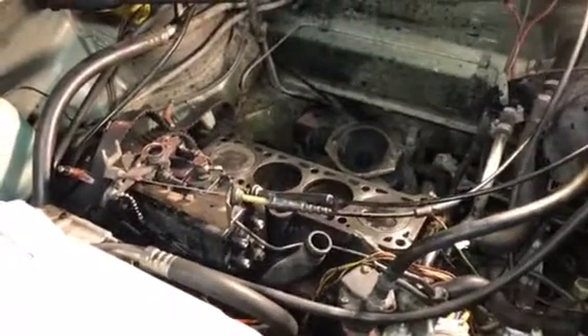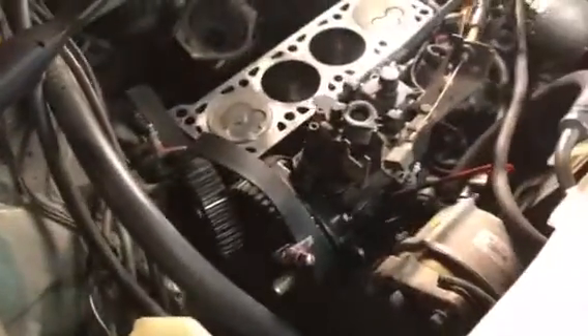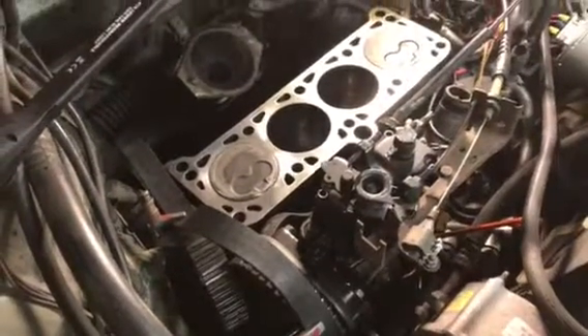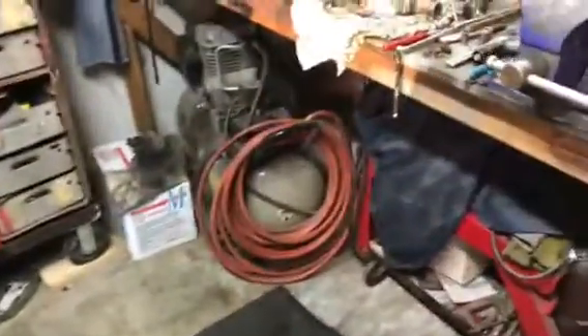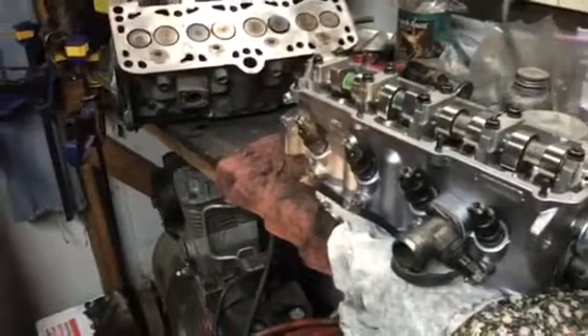When I start stuff up now I'm not driving city streets — I drive down my driveway, down one street, and onto the highway, so there's a lot more stress on it than there ever was before. I typically cruise this vehicle — and I know you're gonna think I'm nuts — but this little truck is not shy of running 80 to 85 miles an hour, and with the traffic on the interstate that's where it runs. So what I'm telling you is this is my fault. I was not warming up the engine the way I know I'm supposed to.